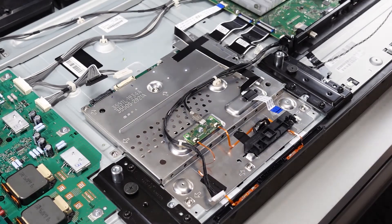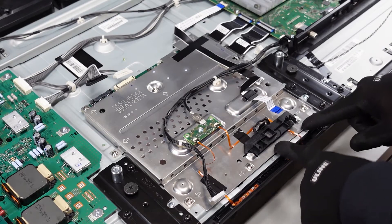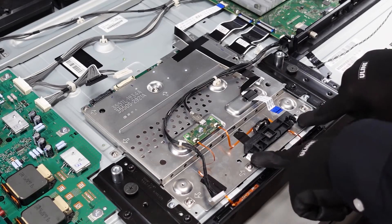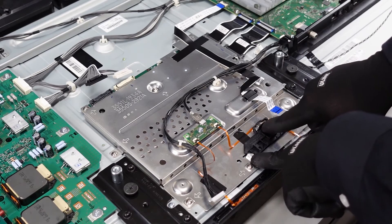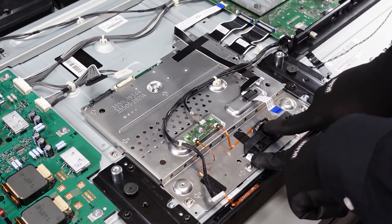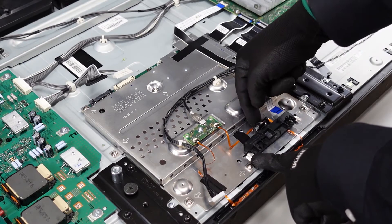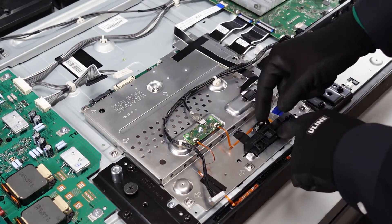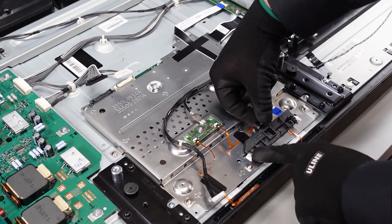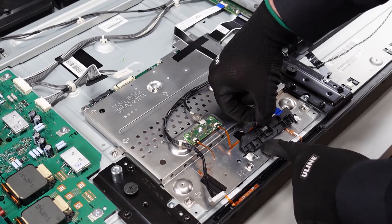Let's get this plastic housing out of the way. It's held in place by these two metal slips here, a clip up top, and there's also a latch you're going to press towards you while at the same time lifting up on the top piece. Press it towards you, lift that straight up, and you can see how it's now loose. It's still underneath these two flaps, so just pull that out and set it off to the side.